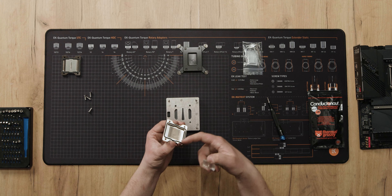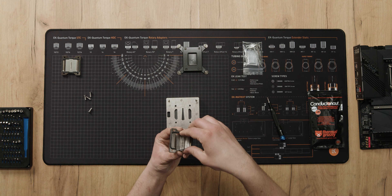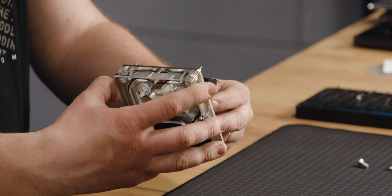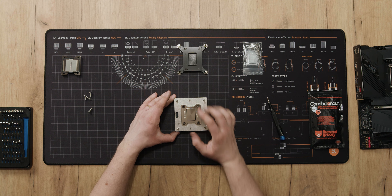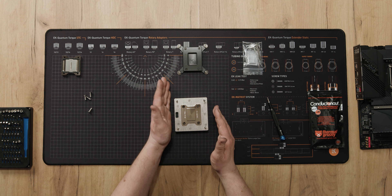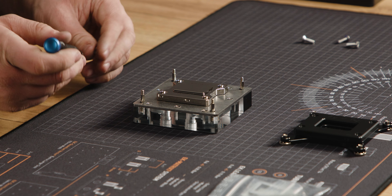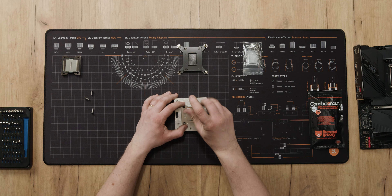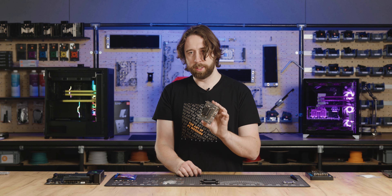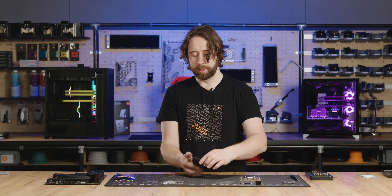Then the new cold plate — check that it has its o-ring correctly installed and the jet plate should fit with the rounded side facing the fins, so it's flat on the top once inserted, and then this will mate up to the block. Make sure that the indexing triangle is where you left it. The cold plate should quite clearly have its contact patch oriented vertically compared with the side that has lights on it. You can't rotate that because the screws are slightly rectangular and the fins would not be perpendicular to the jet plate. This block is now upgraded to direct die in the exact same way as a nickel plexi direct die block. We also have the back plate, which we will need to remove the die guard from.